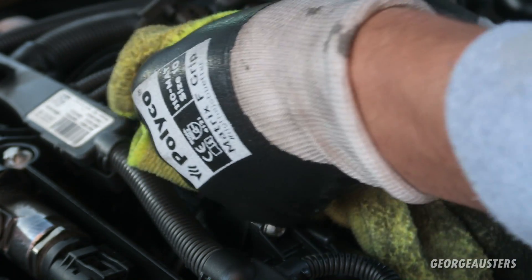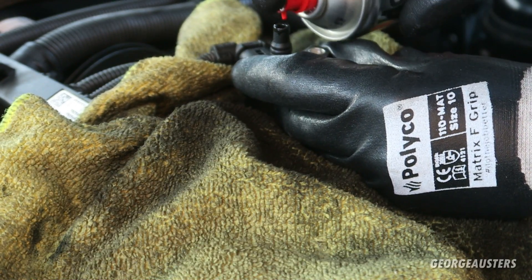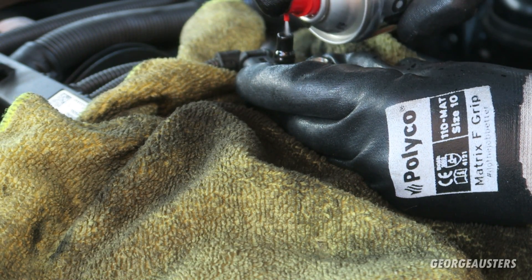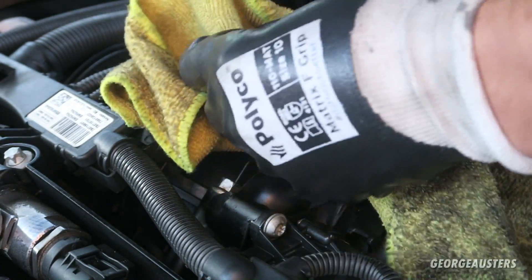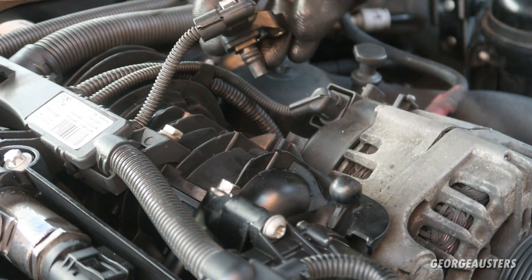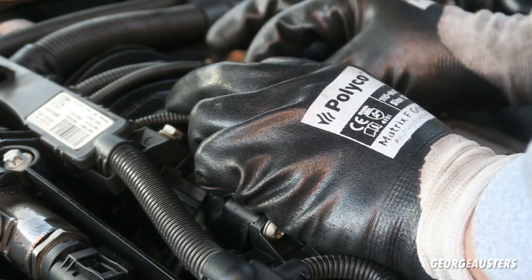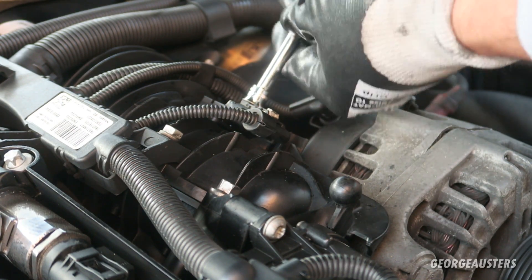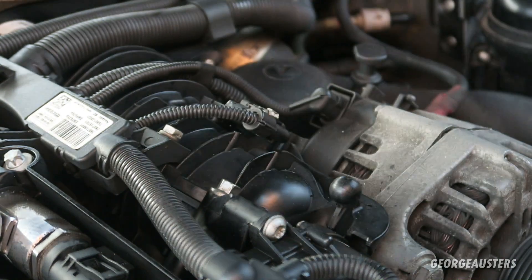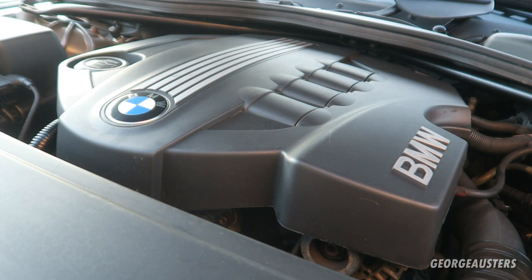It's definitely a lot better than it was. I can actually see the bottom of it now. One more spray of carb cleaner — yeah, I can't see any more black coming out of there now. The O-ring on it still looks good. I'm going to put that back in. It's going in a lot easier than it came out. Put the bolt back in, tighten it up — job done — and then the engine cover goes back on. Jobs are good done.